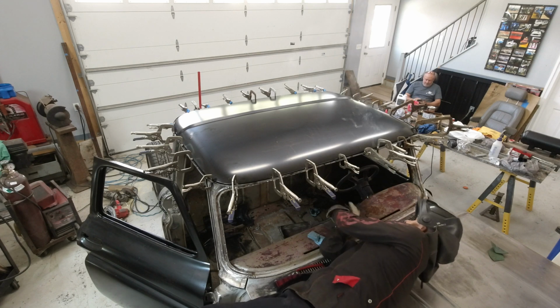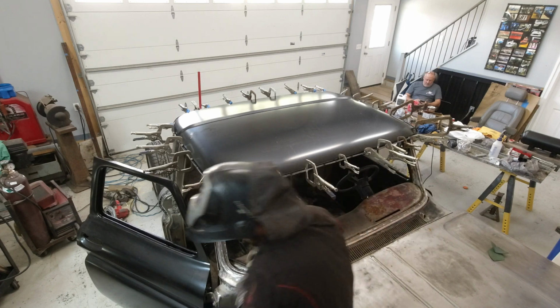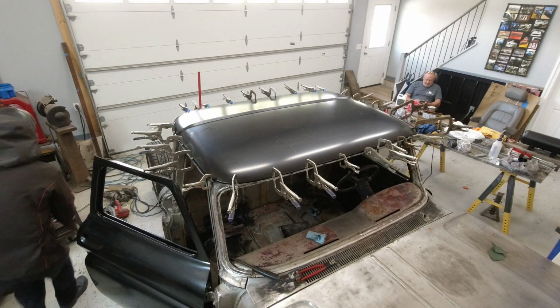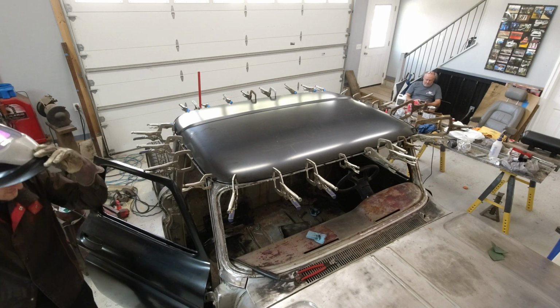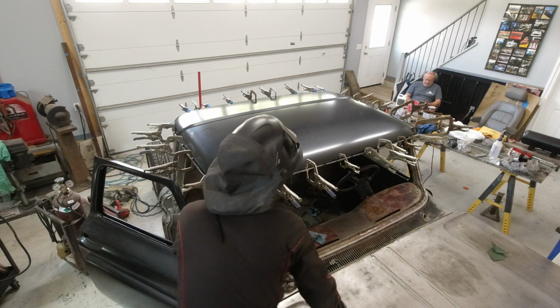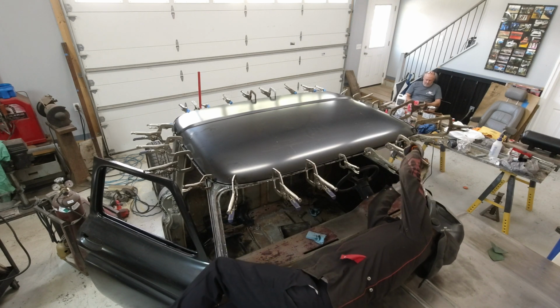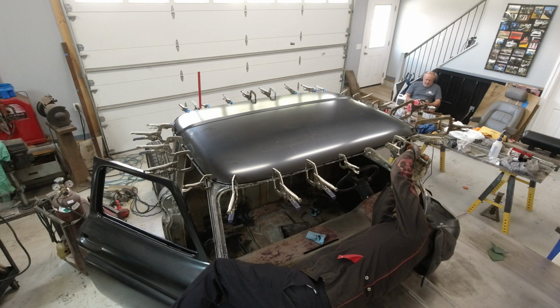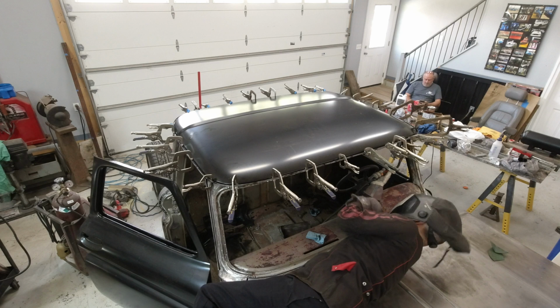We moved all of the clamps to dead middle between the spot welds so that the clamps were focused and working on the areas where the panel bond adhesive was going to be, giving it the best chance that it could. As I said, you only have a 90-minute work time, but in the areas around the welds, since you're heating that metal up rapidly, you're actually cutting that work time down in those areas. You need to work quickly when you're doing this kind of stuff.